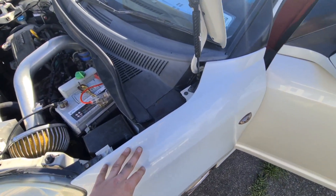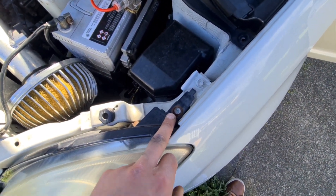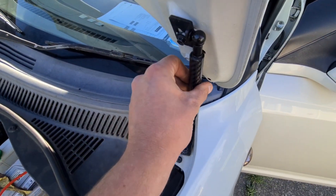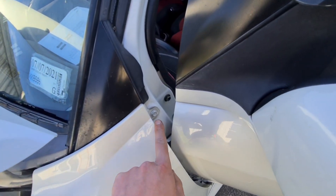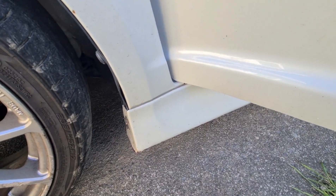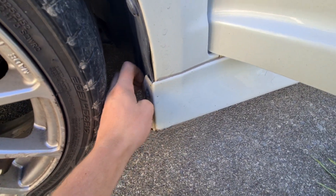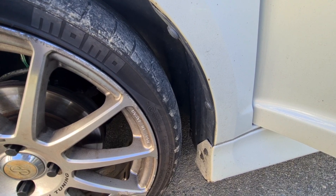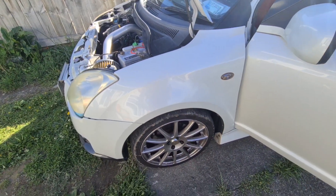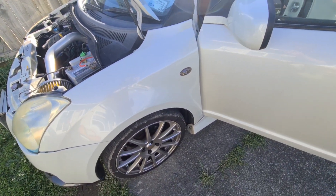To fit them, the fender is going to have to come off. I've never removed a fender before so this will be most interesting. There's a screw in the headlight, a bolt for the fender, another couple of bolts, and sadly the struts are going to have to come off. There's a bolt where the door opens and probably another one down there. There are also some screws here and the inner guard liners will have to come off. I'm going to hyperlapse this part and then we'll have a look at what we're dealing with.